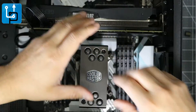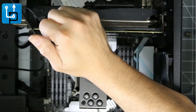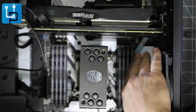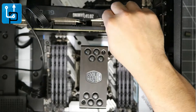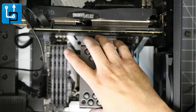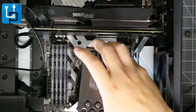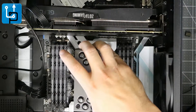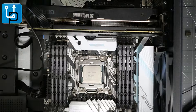They're all lining up perfectly. All you have to do is embed it, put your thermal gel in there, embed it, and you're set. I won't need to move any of my memory or the video card — I can just embed it right there. I'd suggest replacing the thermal paste once a year at least, or once every two years, depending on how hot it gets or if you're overclocking.